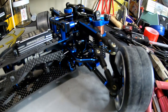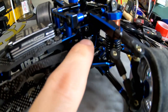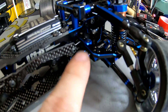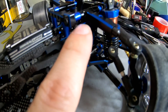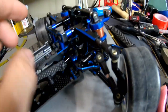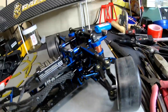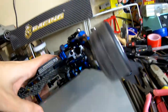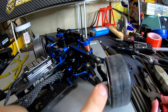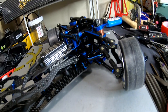The second major thing I found with this particular one was the steering rack - the steering dowel, that silver piece. Both the rack mounted to it and the screw holding the steering arm to that dowel were loose. And the dowel to the bulkhead on the set screw was also loose. So the whole rack was just flopping around. I basically took the front bulkhead completely off the front end, which was only about five or six screws total, and undid the steering link and the upper link on the knuckle.